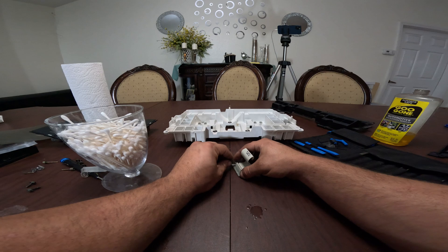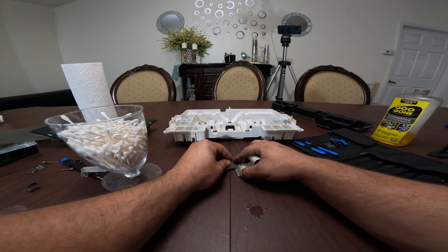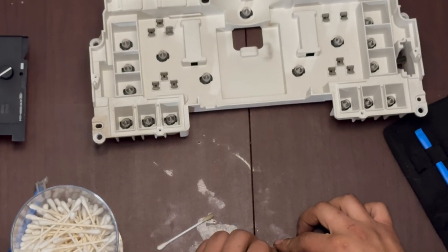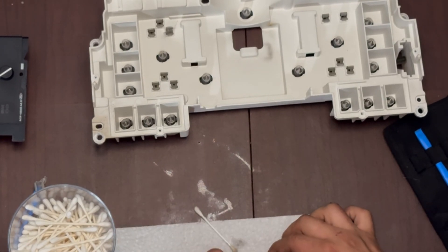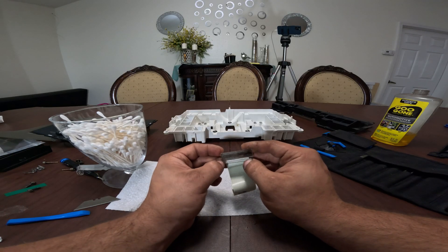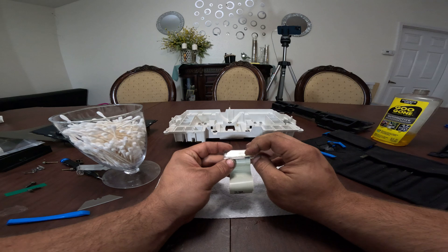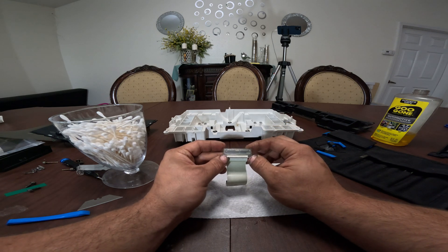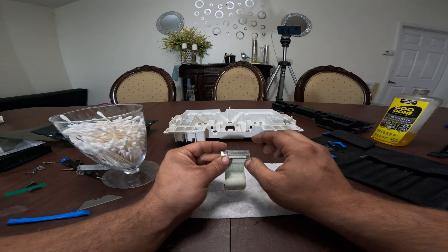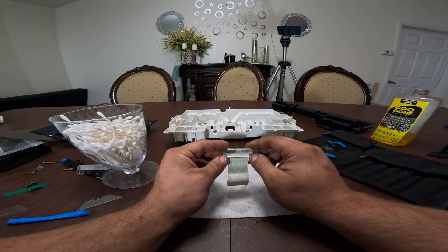You have to be super careful here — please avoid the ribbon cable at all costs. Do not even get close to it with the razor blade. I got the LCD as clean as I can — all the original adhesive is off, scraped with a razor. You should be okay doing that because this is glass. You can see on the inside the LCD itself is starting to delaminate slightly, not just the polarization layer, so contrast may not be perfect, but it should function a lot better than before.